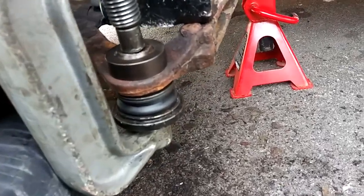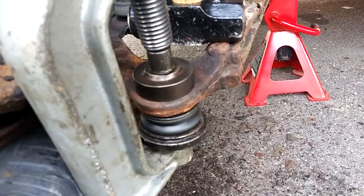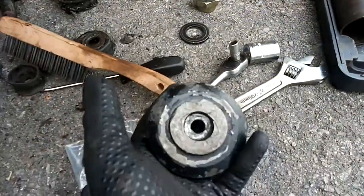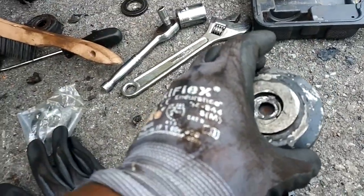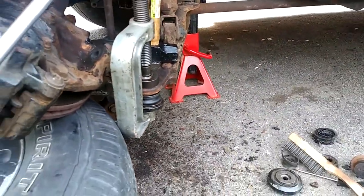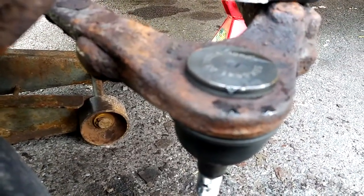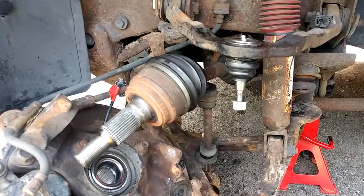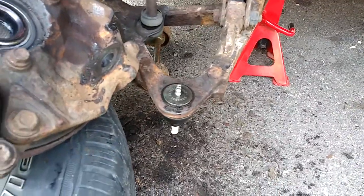My setup: got the small collar on top, just big enough to sit over the ball joint. The ball joint press sits on top of that, and I have the other sleeve with the bigger hole that allows this sleeve to go in — pressing up, as you can see it's going up. Lower ball joint is pressed all the way in. Get your grease fitting in and your snap ring. Upper ball joint, lower ball joint install — we already added more grease; now we just have to get the spindle back on.